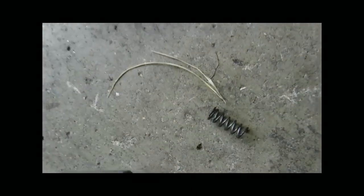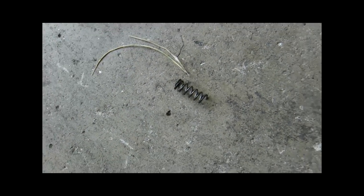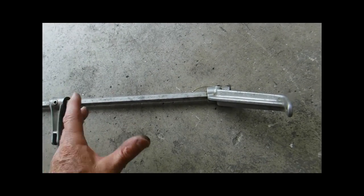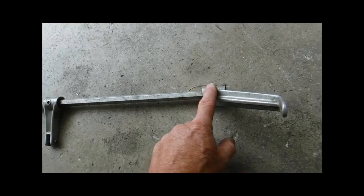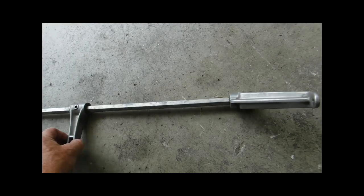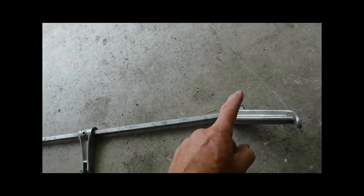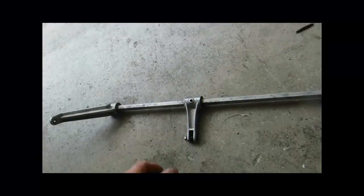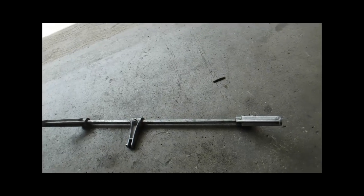You get the idea. And inside there's that little spring. You'd have to have that spring. Hopefully whoever's put the setup on set it up correctly, because your engine grows, these air-cooled engines expand as they get hot. This helps your linkage rod stay centered. Believe it or not, there's a spring on both sides. Let's not go into that. Hopefully you won't have to deal with that. You may want to get a book.